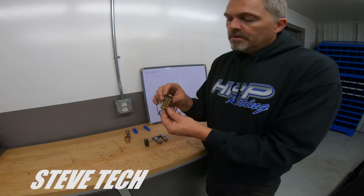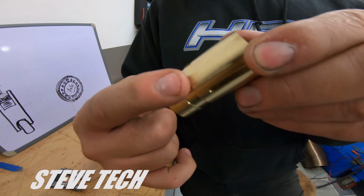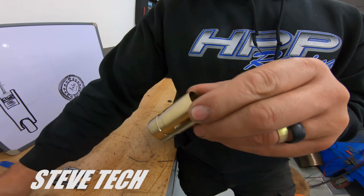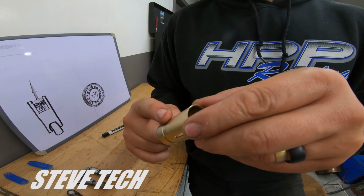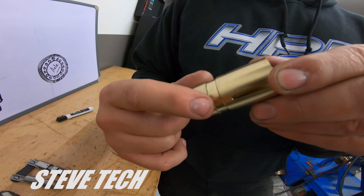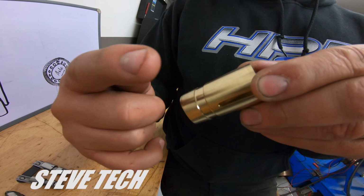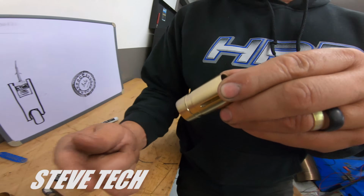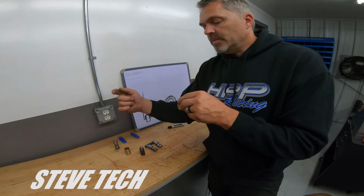all the oil needs to go around this band. So imagine you have 16 of these things, bing, bing, bing, bing, bing, bing, and oil has to come around this band, this really light little skinny band, goes through the oil galley hole, which is fine, and then has to go around another band, and then another band, another band, another band, another band.